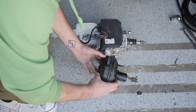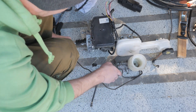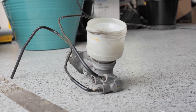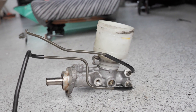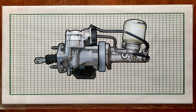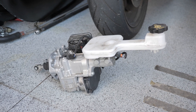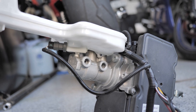Now I needed to make a plan. I was thinking of mixing and matching, putting the Beat's master cylinder on the end of the Tesla booster with an adapter plate, kind of like how this guy did on his DeLorean. That way I could keep the stock brake lines — I mean, they weren't coming off. Also the Beat's master cylinder probably has some special bias stuff going on inside that I'd want to keep, and also the three outlets. But making some kind of Frankenstein setup like that would make it a lot more complicated and longer than before, so I'd have to make new brake lines anyway. Which means I might as well keep the iBooster together, and I'd probably want control of my own brake bias instead of going with the Beat's.